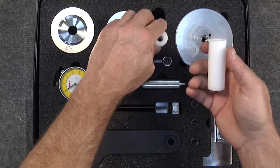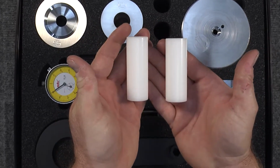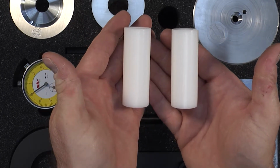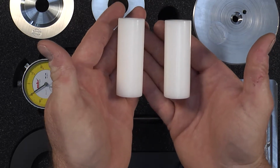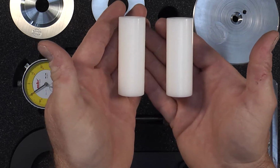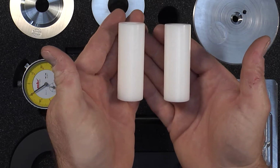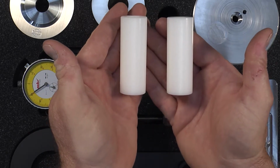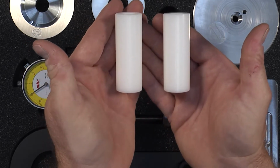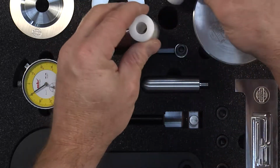These two tools work together, and basically these are made of high-grade Delrin plastic, and they are designed to pass two of the original head bolts through them and hold the crankshaft carrier into place against the bank one crankcase half. So these particular tools were a factory item that are no longer made, and they aid in the assembly of the engine until you get the second half or bank two of the crankcase installed. So these tools keep the deck from being damaged, and they allow you to use two head bolts to retain the crankshaft carrier on its forwardmost end.